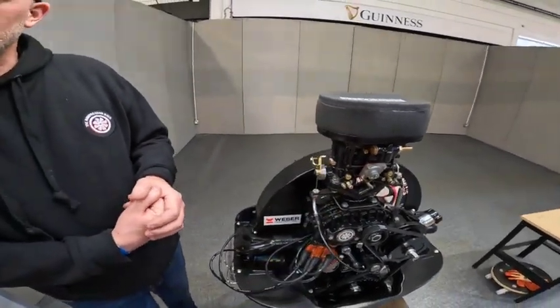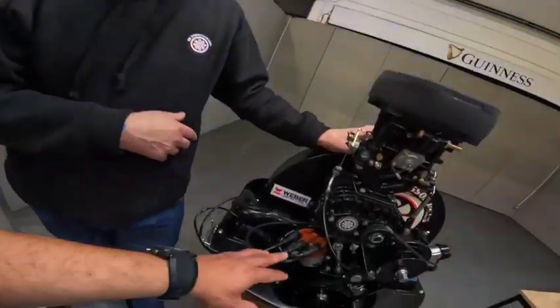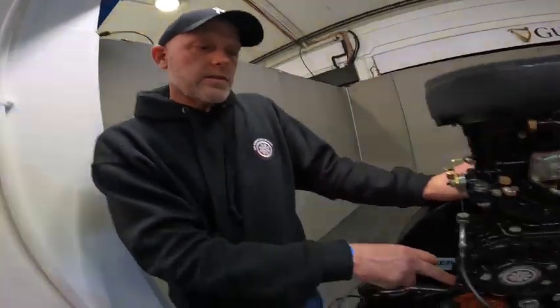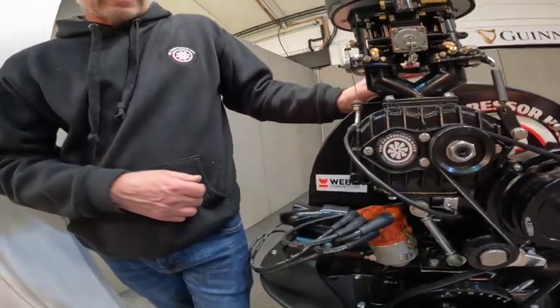It comes with the manifold and carburetor already connected to the intake manifold — the only thing you have to connect is the intake manifolds. If you watch our YouTube channel you'll see we can fit the DCOE kit from start to finish in 30 minutes to the point where you can turn the key. The distributor cap comes with this kit — it's a Bosch distributor cap. We also highly recommend the 123 ignition distributors as the perfect ignition system to go with these supercharger kits.